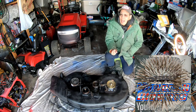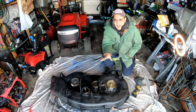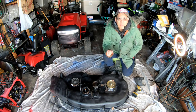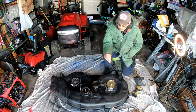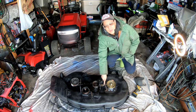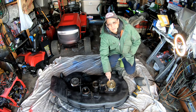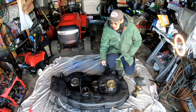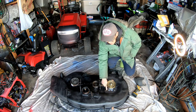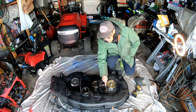So it's the next day. As you know from yesterday's episode, I rebuilt this deck that I got through a trade from my friend Nick from West Iceland. We repainted it, I put a tension arm on the pulley brake, we placed a new pulley, pulley shaft, and spindle onto this part, and added a post for the tension brake arm spring return.